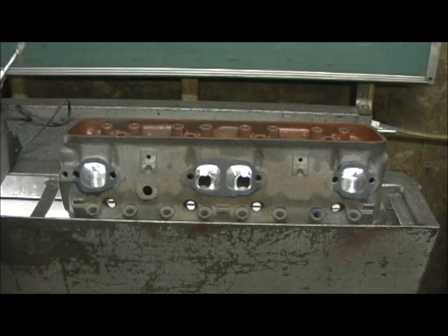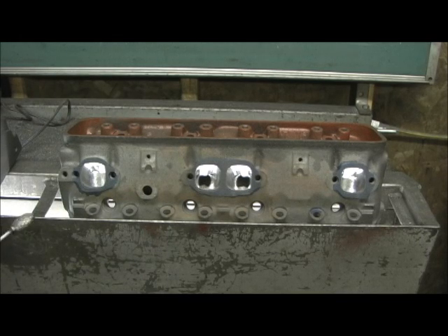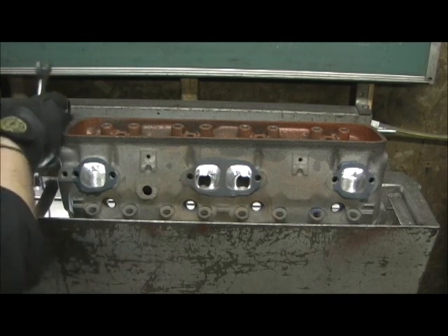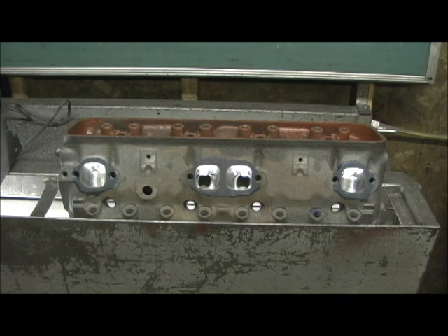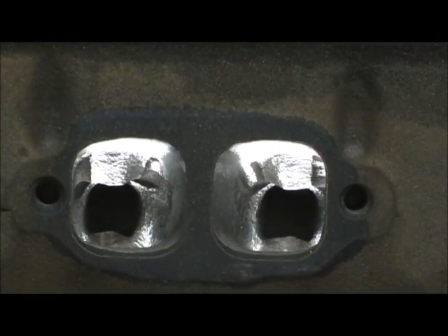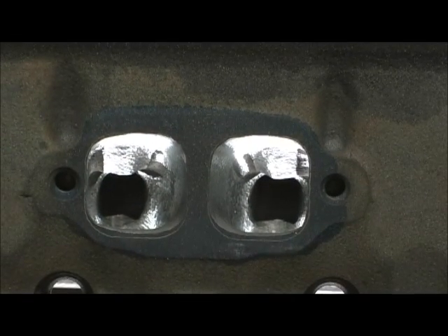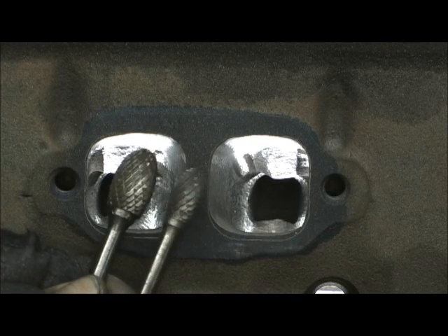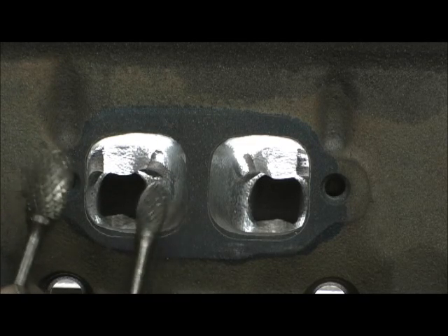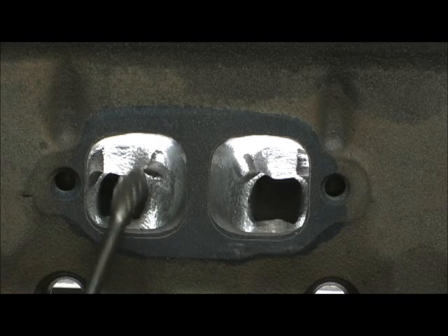Alright, say goodbye to my little friend — this is the big cutter, the big egg. It's now time to say goodbye to it because all the raw material work this cutter is going to do on the head is done. Now we're getting into our final reshape and blending, which will be done with the much smaller egg. In comparison, look at how much meat on the width — this is the one we use for that raw digging, and this one is for the final blending. Both of them are heavy metal cross cuts. After this, I'll switch to my little finger and do my final blending, pulling all the cloverleaf in on both intake and exhaust.